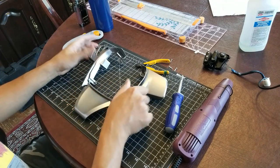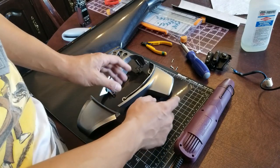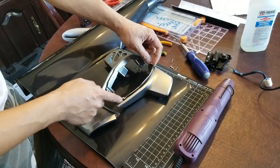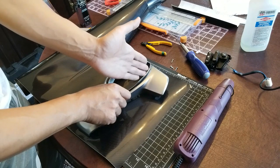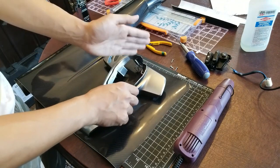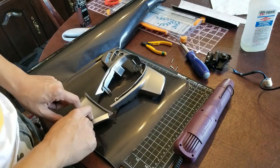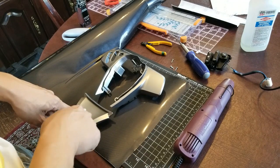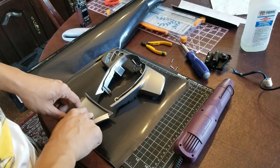Now we're ready to grab our vinyl and start wrapping. You want to cut your pieces of vinyl out so that you have some excess on the edges to work with. Keep in mind we're only wrapping up to this edge here, and you just need enough to tuck it down into the corner. Have enough on the top, sides, and bottom to wrap around. Make sure that when you're doing carbon fiber you keep your weave pattern the same. For me, the weave pattern always goes from the bottom left to the upper right. I'm going to go ahead and cut out the pieces now.